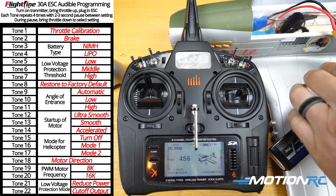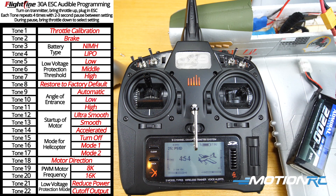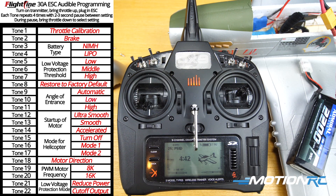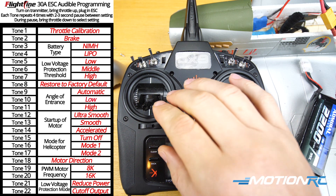Then you're gonna plug in the LiPo. You'll get a series of tones which correspond on the screen — the first four tones will be for throttle calibration. We want this next set of tones — that's your brake. When I hear the last tone I bring the throttle down, it sets the setting.